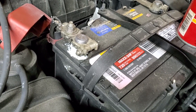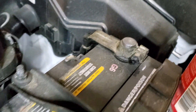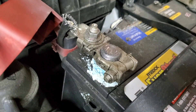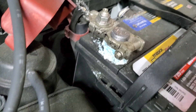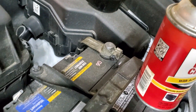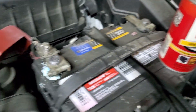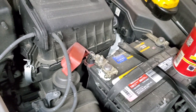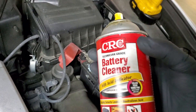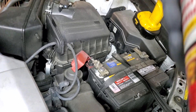Today I'm going to show you how to keep an eye on your battery terminals. If there is oxidation, take care of it. You may need to remove the terminal — remove the negative before the positive. I'm going to use a battery cleaner spray: simple stuff, you spray it on, let it soak for a few minutes, and rinse from there.